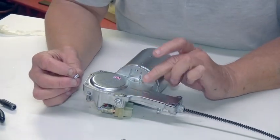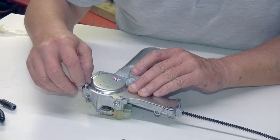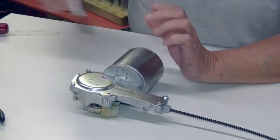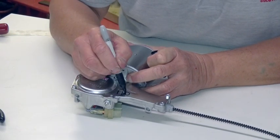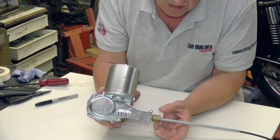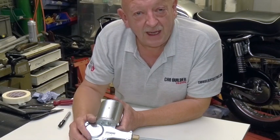Then we can put the cover back on. Don't forget that these little screws, although they're self-tappers, have still made a thread in the casting, so you can just locate the thread and pick up the old thread by hand before you tighten them up. I'll always write on whatever gear is in there — 110 degrees in this case. And there's the first piece of Bundy with the brass nut just screwing on the nose of the wiper motor. If you want to remove a gear or replace it for a different sweep angle, just use the reverse procedure. And that's it.